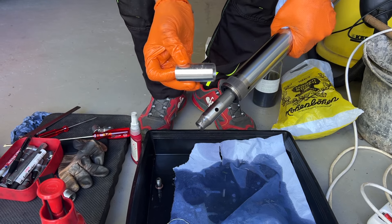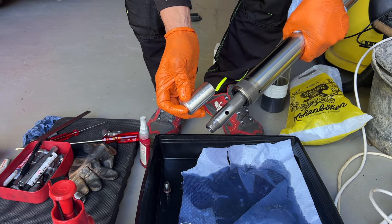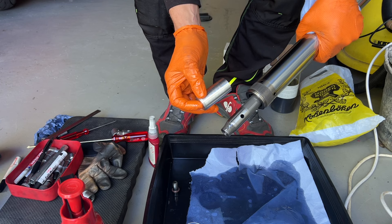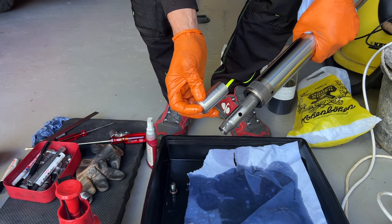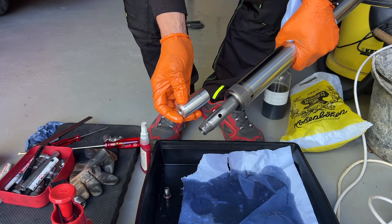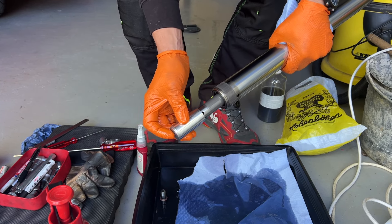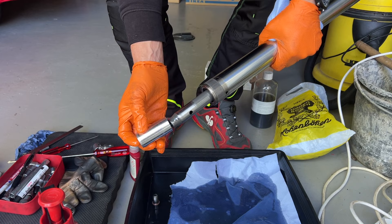Why on a stock bike is there an oil stop that is not working? We did some research and called the dealer. They checked their papers and found this bike used to be a custom bike with a 23-inch front wheel. Nobody wanted to buy it as the large front wheels are not in fashion anymore. So they converted the custom paint to black and reinstalled the old fork, converting the whole front end back to stock — but they forgot the oil stops for the 23-inch front wheel, which was blocking the suspension travel by about two centimeters.